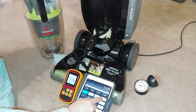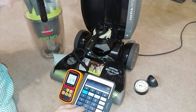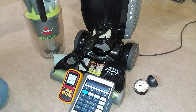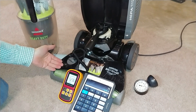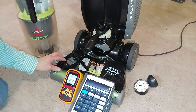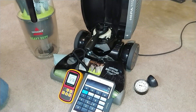52, 36 — okay, 137 CFM. So if I take 137 and subtract 66, which is the same type of measurement all the way through, what we're looking at is a 71 CFM loss through the cyclone assembly. There's a pipe and a tube down here, and it has to go through an angle and then spread out going into the rug plate area and into the nozzle area. So from here through the cyclones all the way down there, we're losing 71 CFM.